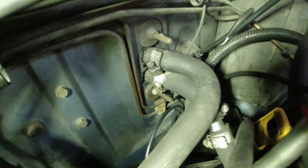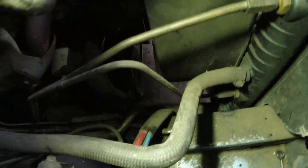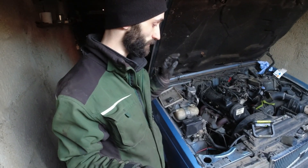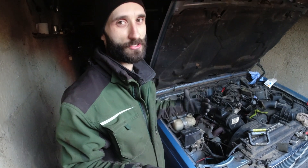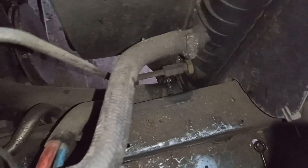I'm not going to replace the heater core hoses today or the small hose that goes from the radiator to the expansion bottle, because I don't have them. I need to measure this one in particular — the inner diameter and the length — so I know what to order, and we'll do that at a future date. They look in quite good condition so I'm not as worried about those. All the hoses don't look too bad but I'm going to do them anyway because we're dropping the coolant to change the thermostat, and since the coolant's really old, may as well do the main hoses now.